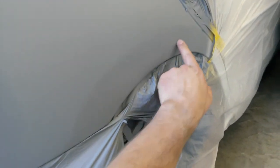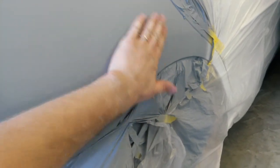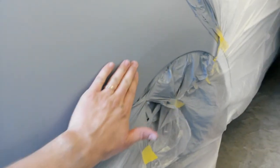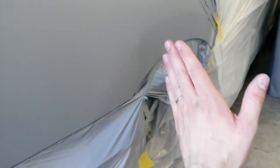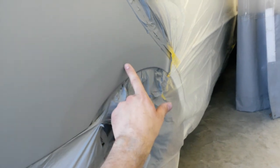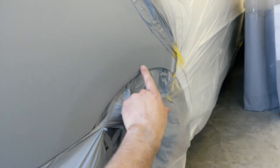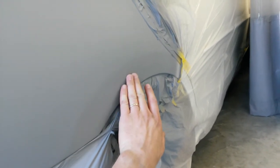The damage was a little further this way than I first thought. After I got the bodywork straight in here, I started to rub over this, and I couldn't feel any kind of a ridge. Went over to the other side, and it's pretty prominent over the entire arch there. So I ran the bodywork out about another 2 or 3 inches further. This had actually come out in the middle right in here. I had a little bit of a ridge running through here. That's where the inner fender well mounts, or this mounts to that on the inside. I guess it had folded over that and pushed a little ridge in it right in the center. So I ran the bodywork out a little further.